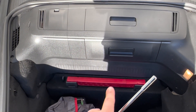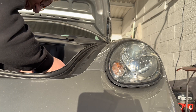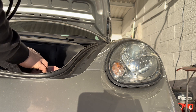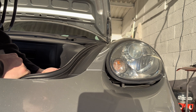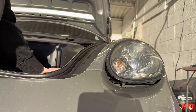At the time of purchase, I didn't realise there was a toolkit behind there, so I bought this. Insert the tool through the centre until you feel it engage into the headlight bracket clamp. Turn it anti-clockwise to the left and it will ratchet and push the headlight assembly out.